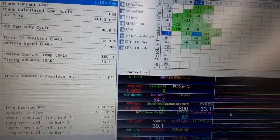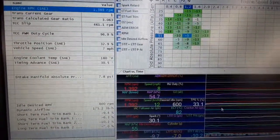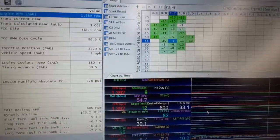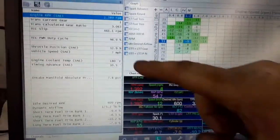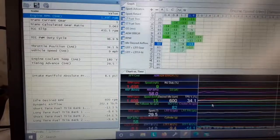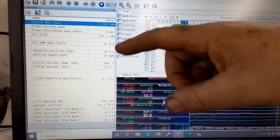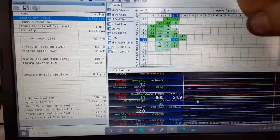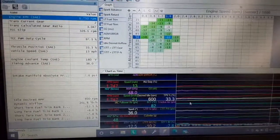This was a previously owned truck so I'm not sure who did what to it. But today's video answers the question: can you switch an earlier external MLPS switch to a later internal MLPS switch? And yes you can. Everything seems to be working fine as far as the transmission is concerned, except for this torque converter duty cycle issue which I think was the original problem that burned up the other transmission. I'm going to dig into the computer more and see what's going on. I already pulled the entire wiring harness and it looks good, but I'll double check it now that I know the transmission is fixed. I don't want to burn this thing up — I just drove it a little bit and everything looks pretty good as far as the electrical is concerned for the gear selector.